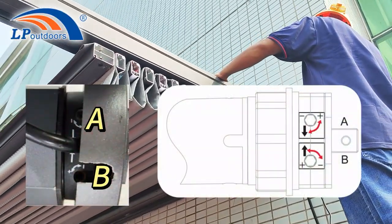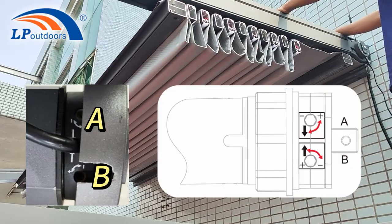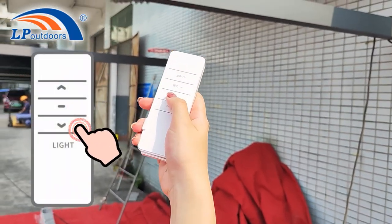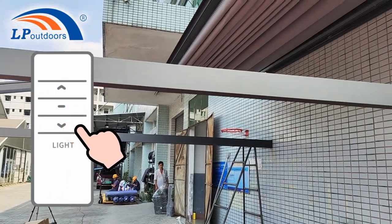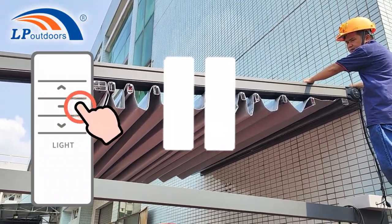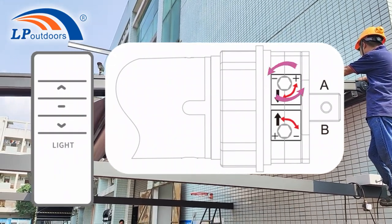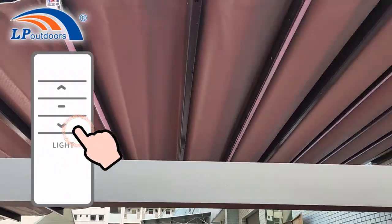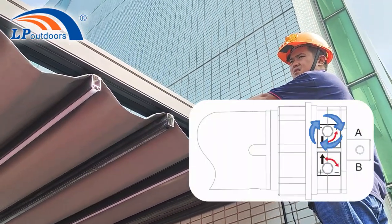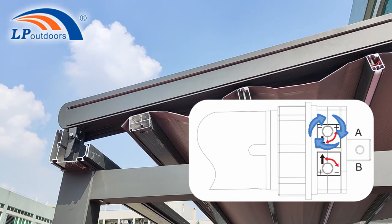We need to use this adjustment rod to adjust the tightness of the curtain. The adjustment rod inserts into the two upward holes in the cap to trigger the switch. Hole A is close to the motor. To adjust the opening, insert the rod into hole A, and then use the remote to make the curtain open forward. When the curtain moves to the middle, use the remote to pause. Turn the rod counterclockwise for more than 10 turns, and then use the remote to make the curtain continue to open until it stops and cannot move forward. Then we slowly turn the rod clockwise and the curtain will extend forward to be tight.